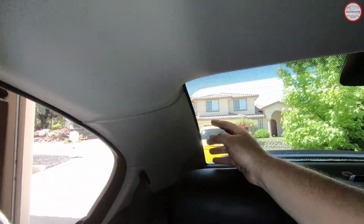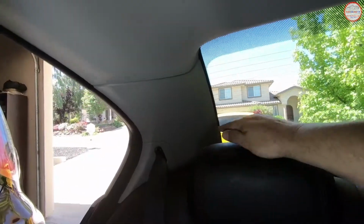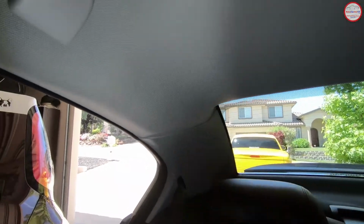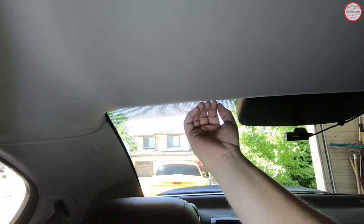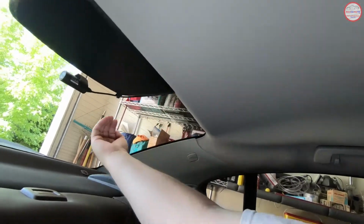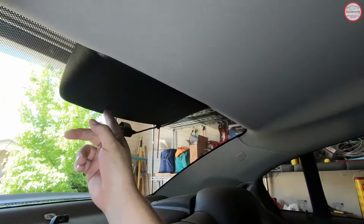So pull in the panel at the top, then pull that panel into the passenger compartment, and it will pull out from the back rear window. And then with those 2 panels out and the handles released, you're able to pull down the headliner from the clips that secure it to the roof, and grab into the headliner a bit so you don't deform the edge of the headliner, and then you'll have access to the connector for the third brake light on the Chevy SS Sedan.